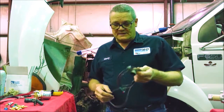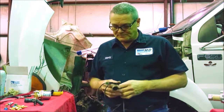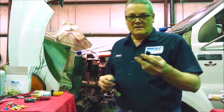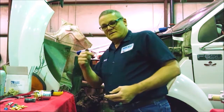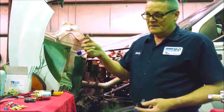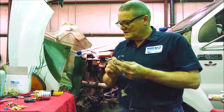That's one reason I have two of them — sometimes when we're running a test, we have two voltmeters on the dash using these harnesses. Now here's your crank sensor. This is a mid-range 2002. The crank sensor is down here. On a Dodge, you'd be near the starter — it's on the driver's side along the oil pan, about three-fourths of the way down, and you'll recognize it by a little shield.